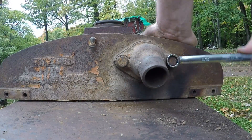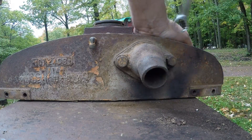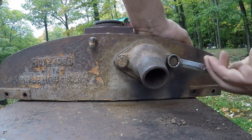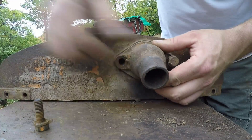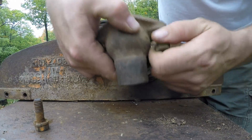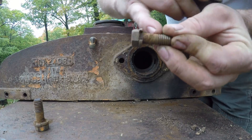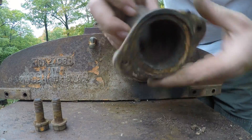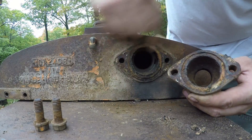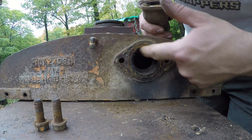Final step is to get this inlet off of the top tank. Fortunately these bolts aren't putting up much of a fight — they're coming out rather easily. That last one was a little sticky but it's out. There's a broken lock washer under that one, pretty common, and lots of rust where the threads weren't engaged. It almost looks like there might have been a thermostat in there, though it's common to see anything like that removed. Looks like there's some sort of retainer in there yet.